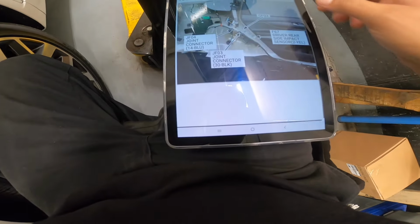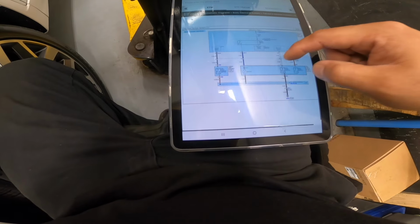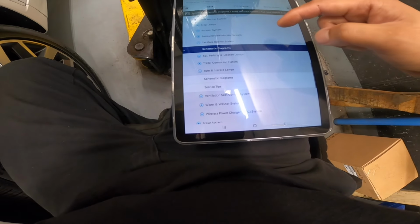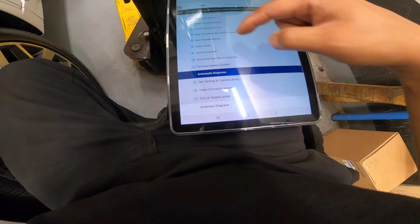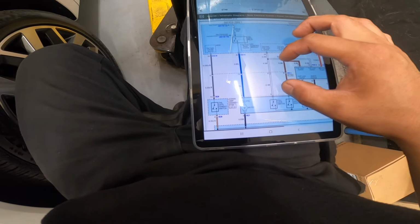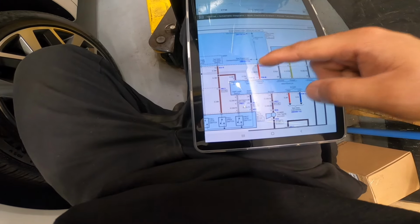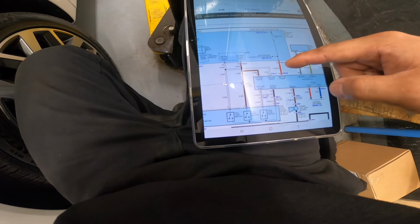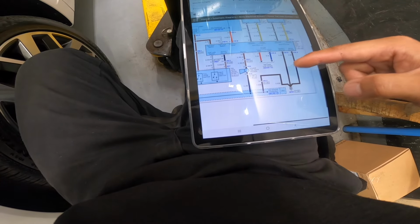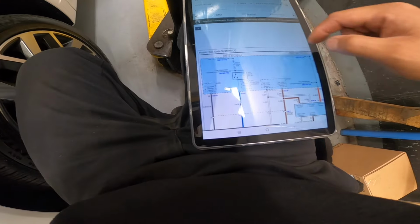Turn signal for the back. So GF03, that's on the left rear panel without power tailgate. Okay, where's the with power tailgate? Without power tailgate. That's not good. So where's the power tailgate? Power tailgate, okay. Okay, power tailgate, same thing. The one earlier was without power tailgate. 20 amp fuse for the door lock. Module 9, 15 amp. Latch. GF03. Okay, that's it, right? That's number 2.